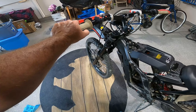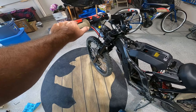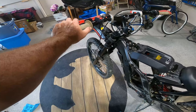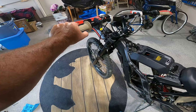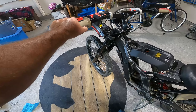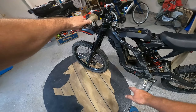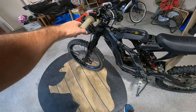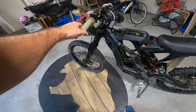There you have it — I put it back together. I have it well oiled, and we're going to give it a ride tomorrow on the trails to see how it works out. You'll remember I put some inner tubes as fork boots, but they were way too grippy. The rubber just stuck to the stanchions too much and rode up pretty quickly. It's interesting — if there was a drier, flexible alternative to rubber that wouldn't stick to the stanchions, that would be ideal.